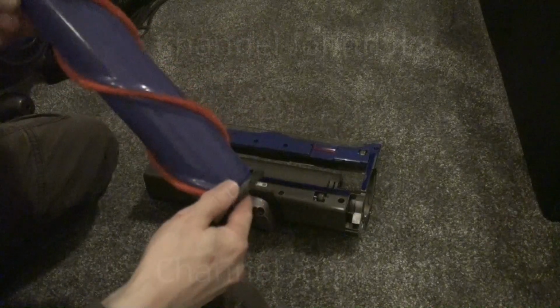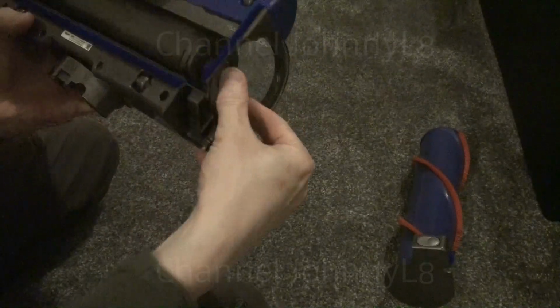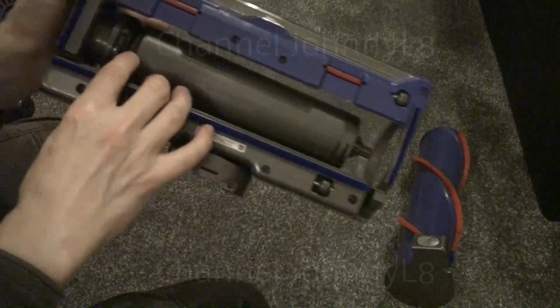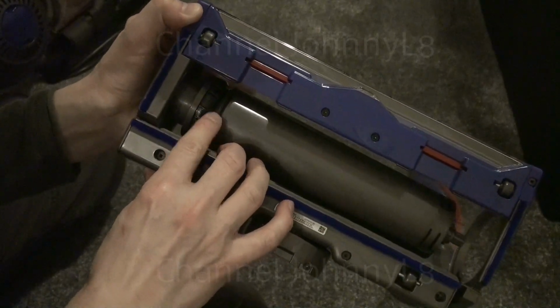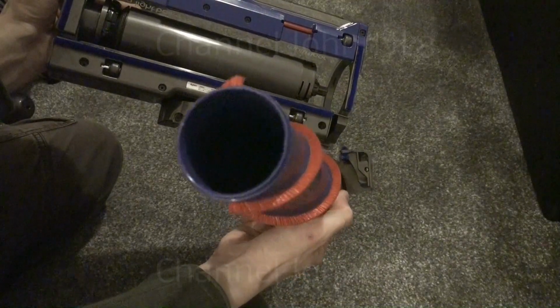So they market this epicyclic drive technology, but you can't really see any of that. And this spindle seems to drive the brush bar, and it fits into a groove at the deep end of the brush tube. There's also an O-ring seal at the other end of the motor spindle, which I think is there to prevent dust getting down into the brush tube and causing problems. I guess this stuff gets too technical for marketing, but is pretty interesting in a geeky way.